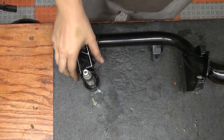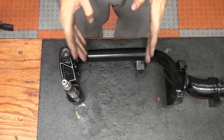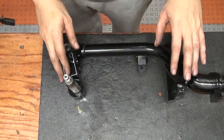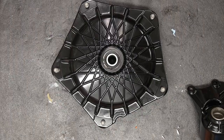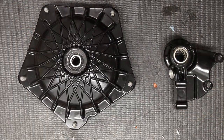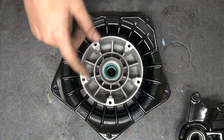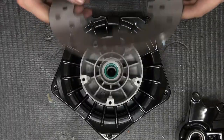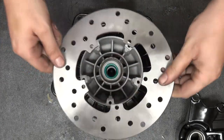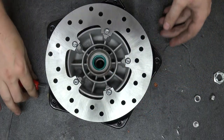In order to put a disc brake on a rally, we're using a PK fork which is lower than a PX fork, and you must run a PK shock. However, the hub is a Grimeca PX kit — you can ultimately just swap it over onto a PK fork as well. When we put the disc on, there's a little arrow that points towards the direction of rotation — I found out if you point that towards the hub, it all works out.